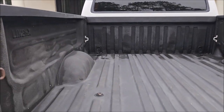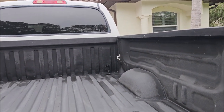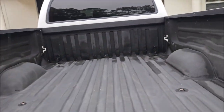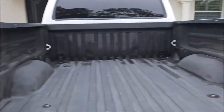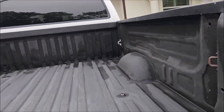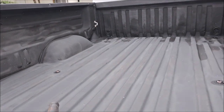This Raptor Liner install will apply very much like the Versa Liner and Duraback 18. What I like is that when you roll it, it's a bit more textured — so if you're looking for something non-skid for boats or whatever, that's generally what I use. I scuffed this really well using my rotary polisher with a nylon brush, then sprayed it down with Tiger's Blood, scrubbed it, and pressure washed everything out. Now I'm waiting for it to dry.